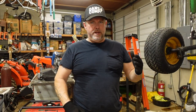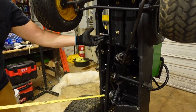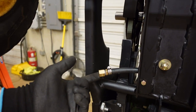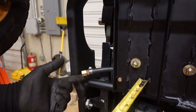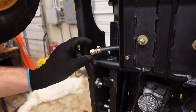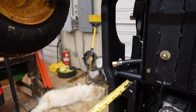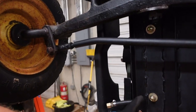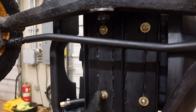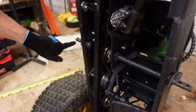We got the mower all put back together. If you look in here, this is the oil drain I talked about — I ended up getting a 90-degree fitting from eBay, it comes off the back of the engine. I got a strap right here holding it so it can't flop around, and all I'd have to do is take off this cap and the oil should drain out. For the belt guide pulley we used grade 8 fasteners with locking nylon nuts to put the engine back in.